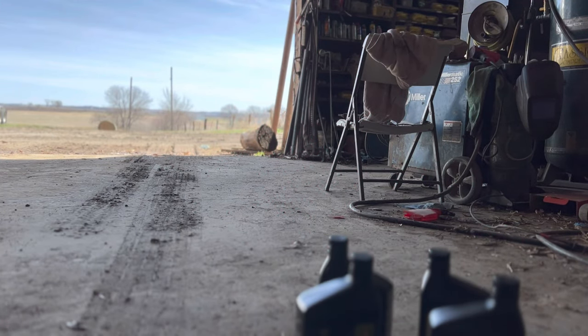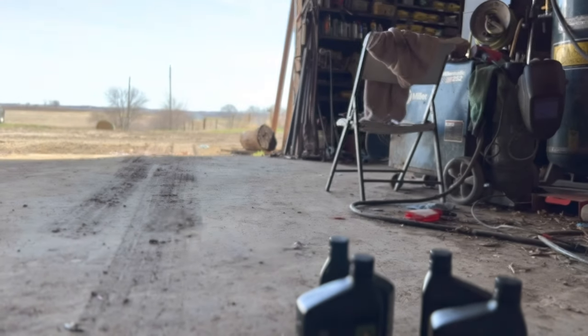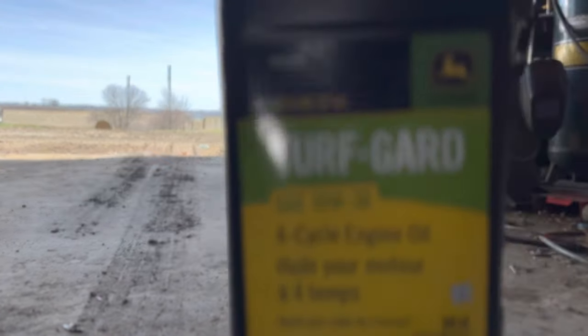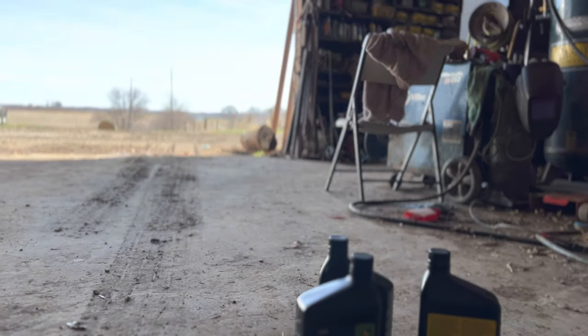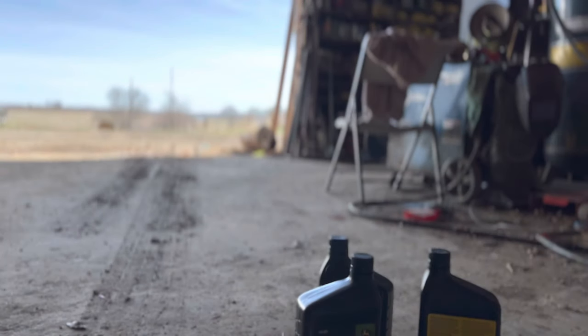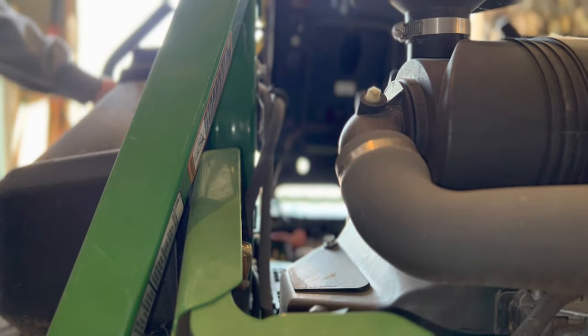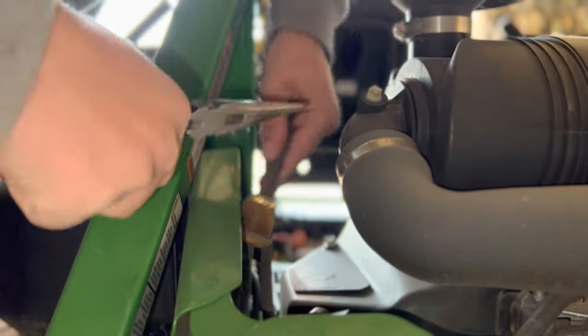We got the parts here. We are going to be swapping out the oil filter, and we also got a fuel filter. We will be installing John Deere brand Turf Guard 10W30 engine oil. I also got new blades which we will break out in a couple moments, and we're also going to blow out the air filter because it needs that. We're going to let that oil finish draining and while we do that we are going to pop off this old fuel filter and swap them out.